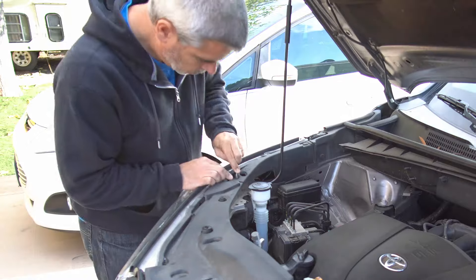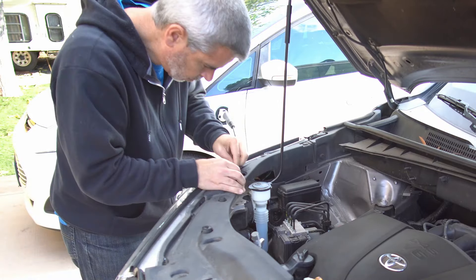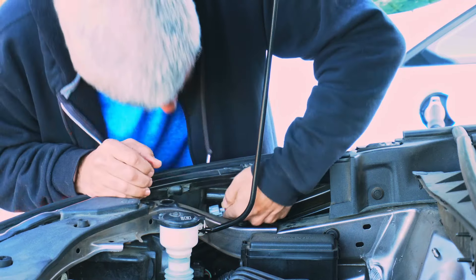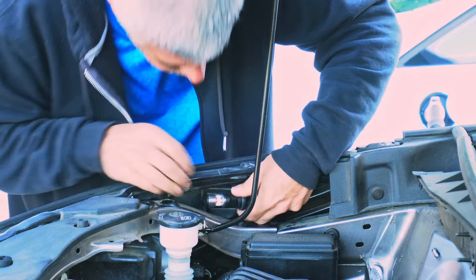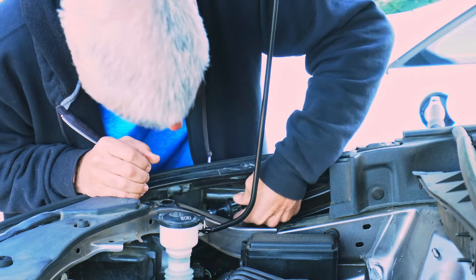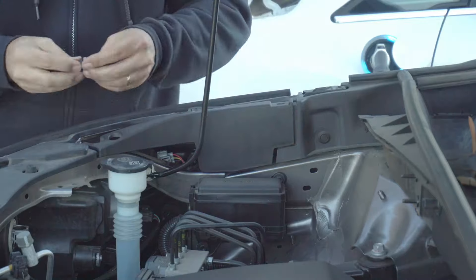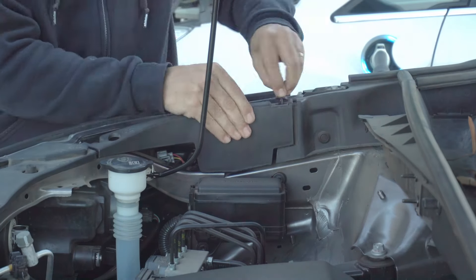So this is a great solution, it's really quick. On this car, I'll show you really quick how easy it is to replace. All we're gonna do is remove one little trim piece here, and then we're gonna just twist and pull out the old bulb from the fixture, pull that bulb out, swap in the new LED, being careful not to touch the little LED segments on there — you don't want your finger oils on them. Snap it back together, slide it in, and put the trim piece back on again, and you're done. For most cars, it's really that simple, some require a little more work.